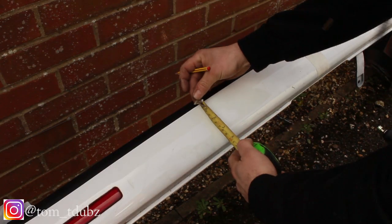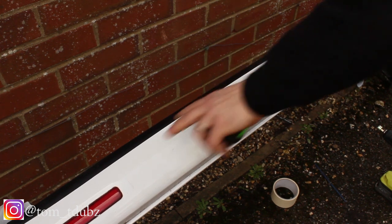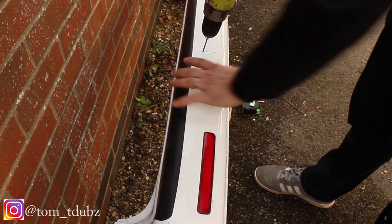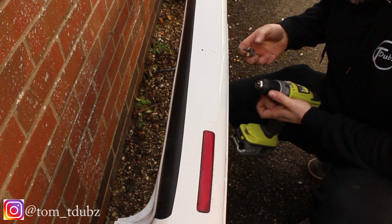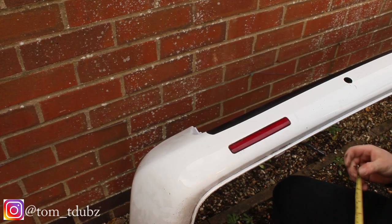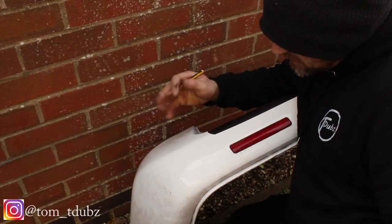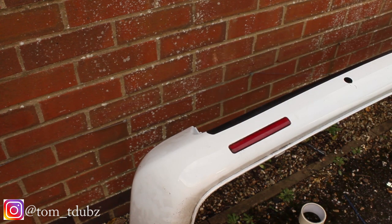What I've done is mark down about an inch from the protective sticker on there — they won't look out of place as they'll be in symmetry with it. Let's get these drilled out. I'm going to start with a little pilot hole on the actual cross marks, and then in the kit you get a cool little step bit to drill out the bigger hole. Going an inch and a half from the ridge because the bumper curves a little — that way they'll be roughly in line.